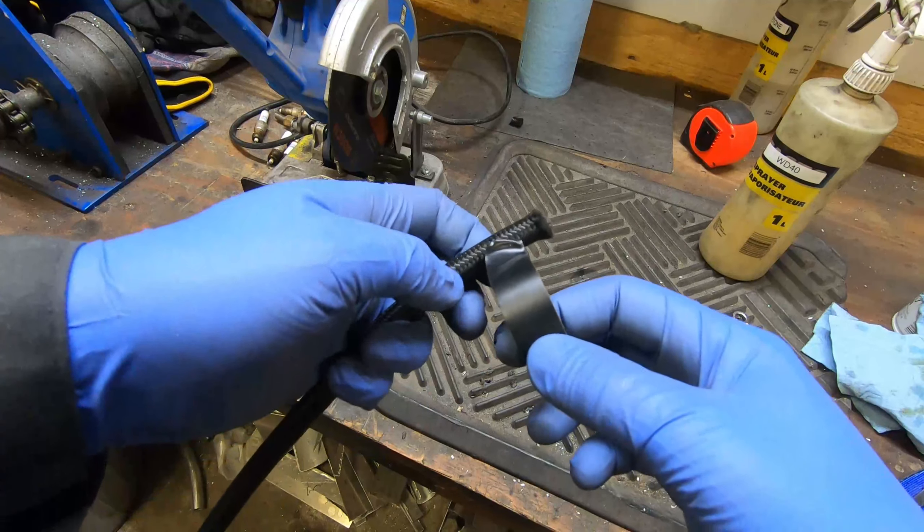The oil feed is basically done. I'll connect it in there, the line will come up - I'm going to have it basically in this orientation. I'll fasten it down better once completely finished, but it'll basically run here - that'll keep it away from the exhaust - and then at the top it just connects into a fitting going into the turbo feed. I'm a little concerned about potential heat on the top, especially since it's a nylon-braided hose and not a steel hose. I think I'll either wrap that hose with reflective tape or buy a blanket for the turbo. I have some electrical tape on the fittings and I'm going to use this Hand Tool Rescue wrench because it adjusts quite finely.